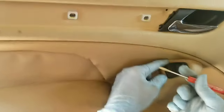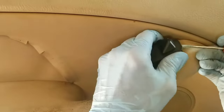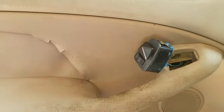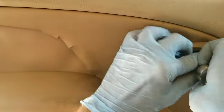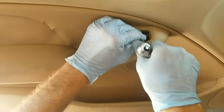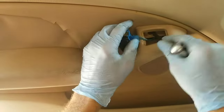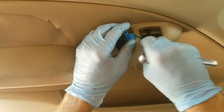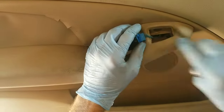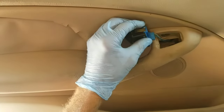You'll need to use a small flat tip screwdriver and pull this driver side switch up. You'll see one more screw right back in there — take that out. Once you get that loose, if you can't get the screw out, you might want to use a magnetic retriever to get the screw out, or just remember that it's in there. Sometimes when they slip out, they go down in the holes and you can end up losing them.